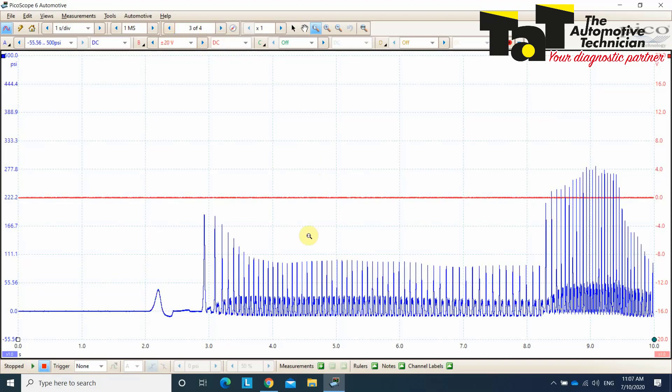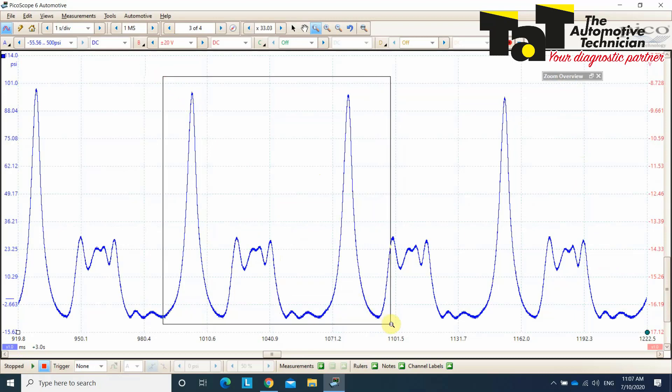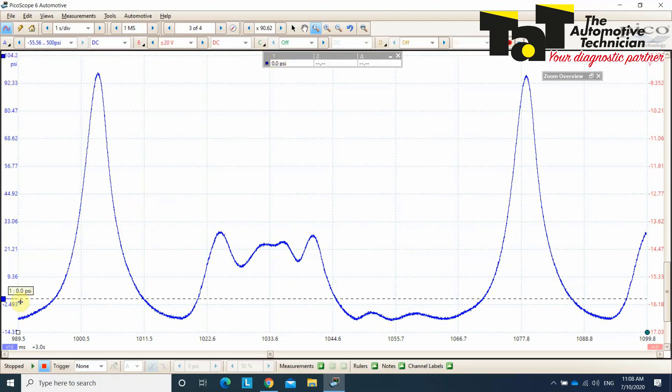Let's go back and take a look at our capture. We can see here is where we've stabilized after starting, so that's the main section I want to look at. There's a whole day course I've run on this in-cylinder compression waveform so I won't go into too much detail, but the main thing we're after: I've set a cursor at 0 PSI as my atmospheric pressure line. This is compression in the cylinder achieving close to 100 PSI — correct for a running engine. Down here is the exhaust valve opening after the expansion stroke. This is the exhaust valve opening, so we should return to atmospheric pressure. Sitting here at idle I've got near on 23 PSI of pressure in the exhaust — and that is our problem area.